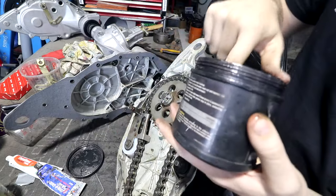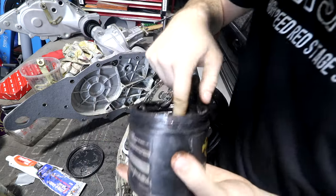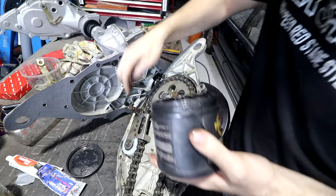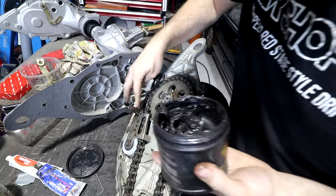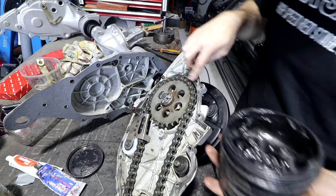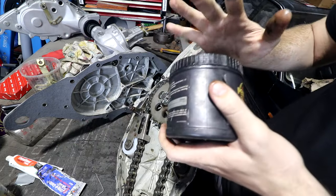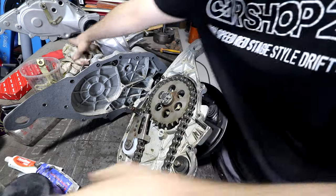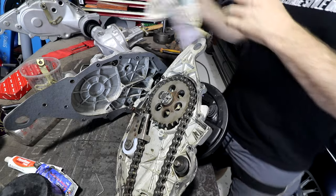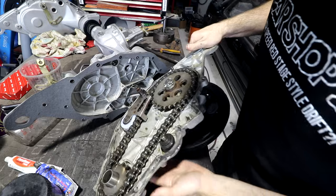But if you slide around on the top, the coins will all sort of slide around and move together with each other. Because this moly grease is really good for high pressure stuff where you're gonna have a lot of pressure on it and it needs to not be squeezed out. And it's also good for stuff that's gonna be sitting for a long time and being used for long intervals, because even when all the grease part of it's sort of broken down and washed away, you still have those molybdenum particles in there helping everything move and slide and not destroy themselves. So that's all greased up.